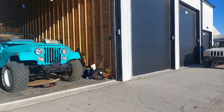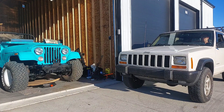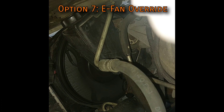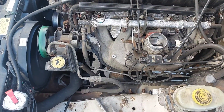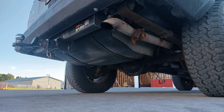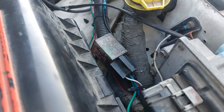So let's say you've put in the best possible gas, have the manifold and injector heat shields, pop the hood open at every stop, and you're still getting heat soak. The final boss heat soak has been unable to defeat is the electric radiator fan. DNA in the Garage had this excellent idea: run a switch to a time delay relay to override the radiator fan and let it run for a few minutes after engine shutdown. The electric fan is conveniently positioned to blow air right over the exhaust manifold and fuel rail, evacuating the engine bay of hot air so the next start runs good and smooth. This is what cured it for me — I never had heat soak again after wiring up this fan override.